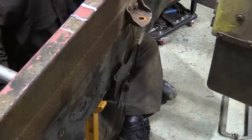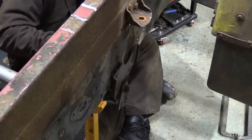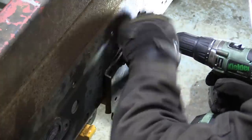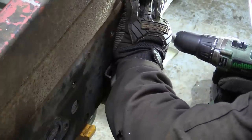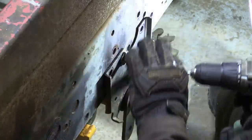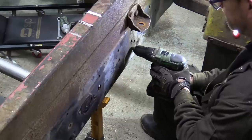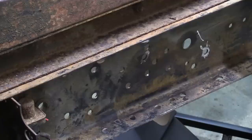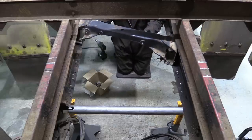The plan here is exactly the same as the front's. Bolt the spring hanger up using the lower holes I've just drilled, then transfer the upper hole centres onto the chassis. And then measure up to the last pair of holes for the crossmember. Lastly, drill through to 13mm. Oh, and then copy the whole thing onto the side before sliding the crossmember in to be fully bolted up.